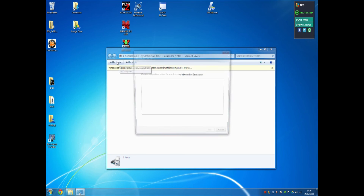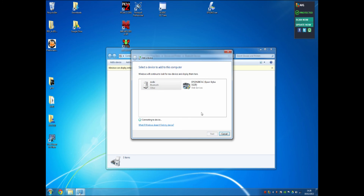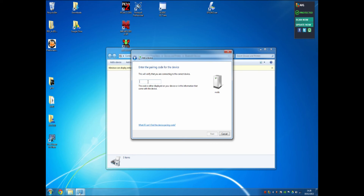Click Add Device and it will try to find the Nodiz. What usually happens is it comes up as Other, and then after a few moments it changes to say Nodiz. Do not try and connect to it until it's changed to Nodiz. Once it has, simply click on it and hit Next. Here you get a choice to enter a pairing code — choose Enter the device's pairing code and type in that serial number. On this unit it was 4023, but on your Nodiz the number may be different — it could start with 3000, 5000, or 7900, but it will always be a four-digit number. Enter it, then hit Next, and you'll see it will pair up with it.